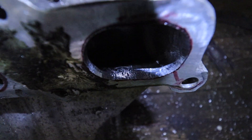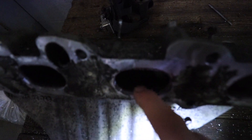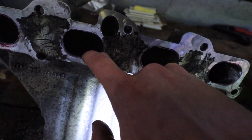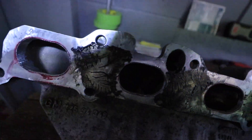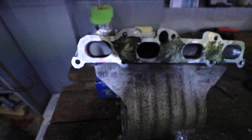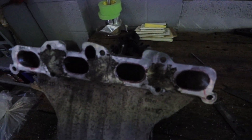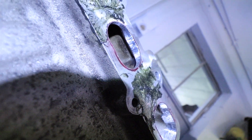If you guys can still see it, you can tell that the ledge is smoothed out — it feels nice. I still got to do the tops. You can see I did hit the mouth area a bit, though I wasn't gonna go all the way up to the lines, so I left a little. Some of that is a little overspray from the Dykem. This stuff held up — it's been on there for months, about two months, sitting on there ready to cut. So I've got the mouths where I want them to be and I'm gonna hit them with sandpaper once I'm done. But first I'm gonna hit the tops and get those smoothed out — you can see how heavy that lip still is on the top.